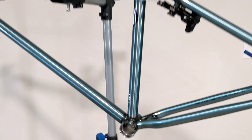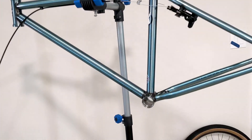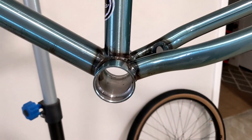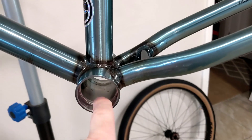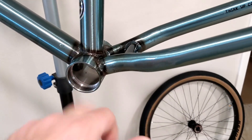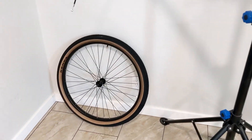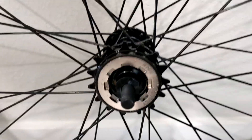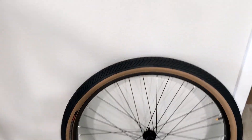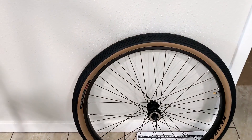I'm not going to do a full build video, just some updates as I work. I've got all my tools here. Last night after I filmed the parts video, I installed these brakes because they're easier when the bike is upside down. There was some burring, probably from hammering out the old bearings — they were really stuck — so I filed it down smooth. I also did the tires, put in tire liners, tubes, and the freewheel. There's the 15-tooth freewheel right there. These tires look pretty nice — not super skinny and not super fat, they say two inches but seem a little bigger.